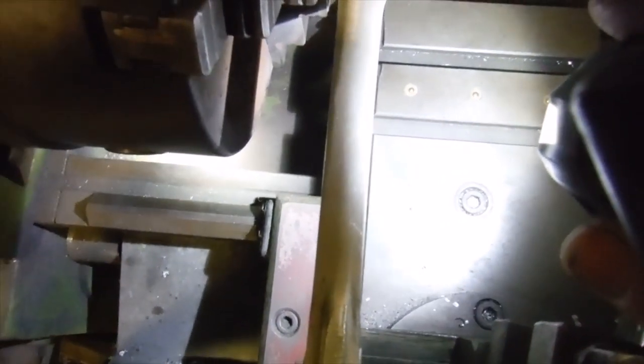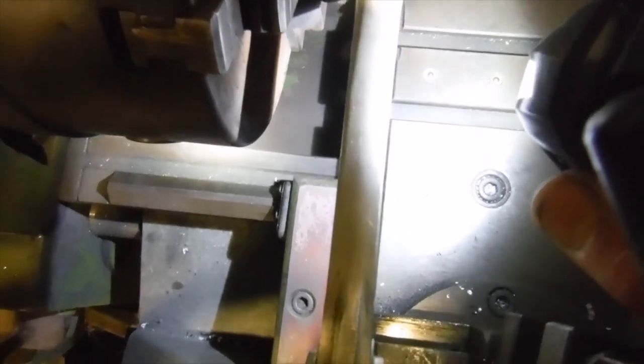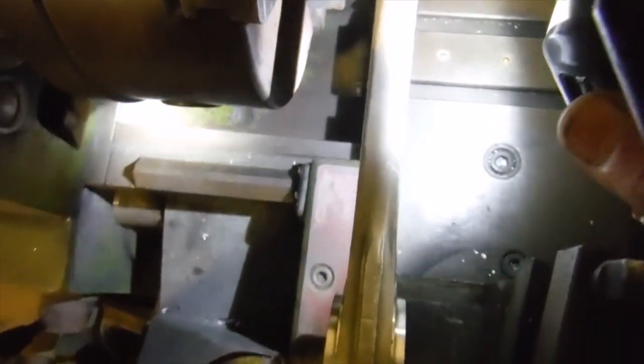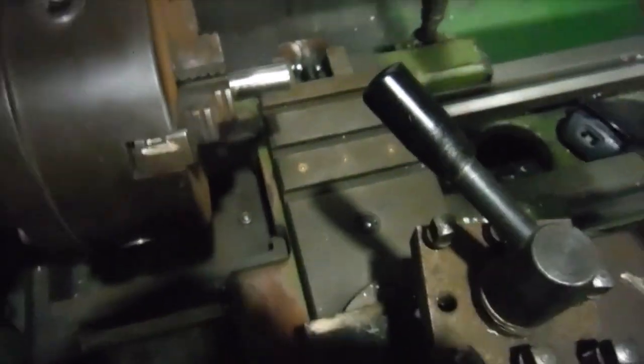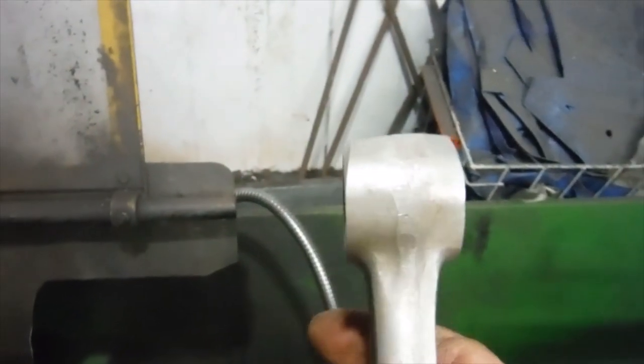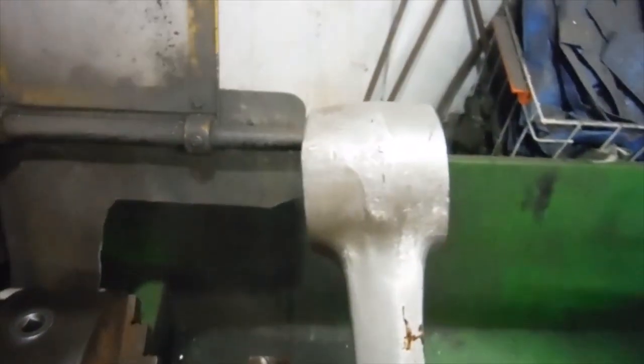There's a slight out of step and we'll come to why in a moment. There we are, the conrod's turned over. Looking at that cross slide again — I would say that conrod is straight as far as its fit on the gudgeon pin at the small end goes, and through the length of the shank to the big end. The slight out of step I think is down to the inconsistencies in machining at the small end of the conrod, which is rather rough on some of these Indian conrods especially.